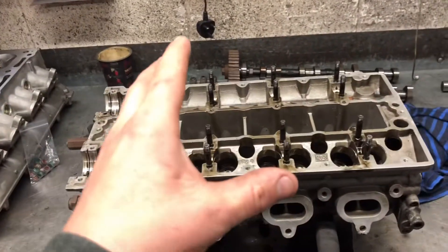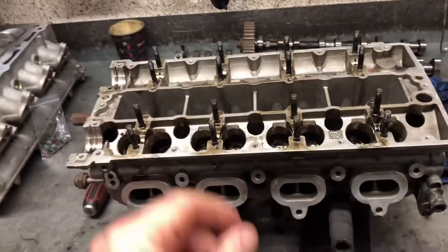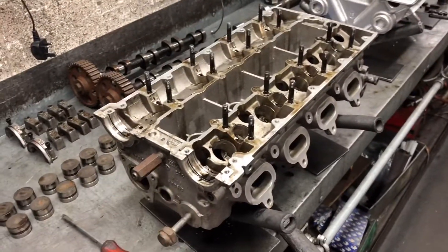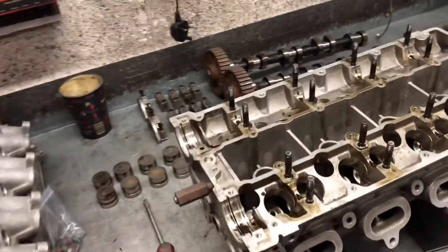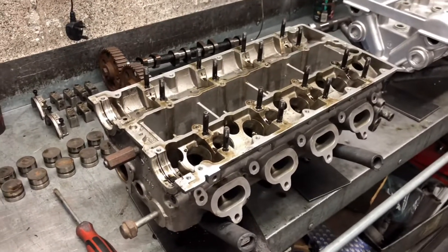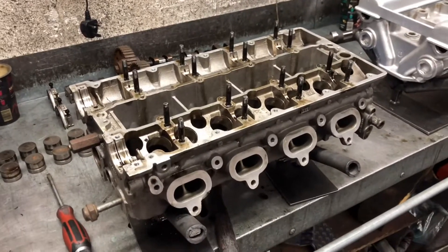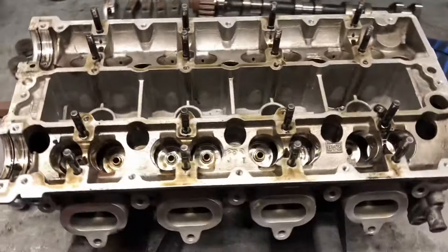What I want to do a video on today is this cylinder head — this is a Sierra Cosworth cylinder head. What we're going to be doing is giving it a birthday. We've tucked the valves out already as you can see. The valves and seats are not very good, we've checked the guides and they're absolutely fine — it's actually a really good head but the customer wants to freshen up the engine. We've put ductile iron liners in the block, we've got new pistons and rods — all the business to go in there, so this head's got to be good as new. We're going to run you through some of the processes and what we do.